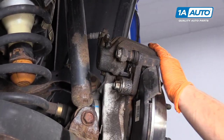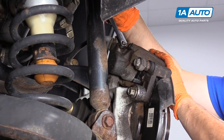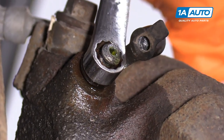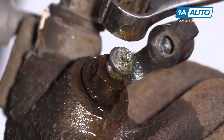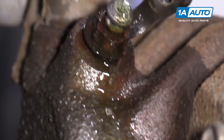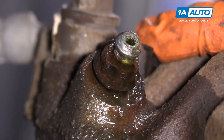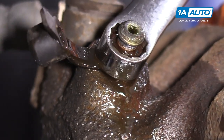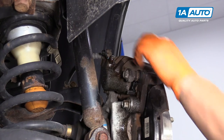Now that we have the rear brakes all together with the caliper mounted on this 2012 Equinox — because we had opened the bleeder screw to push the caliper piston back — we're just going to gravity bleed it. No need to touch the brake pedal at all. We're just going to watch and make sure fluid flows out with no air bubbles. See those little air bubbles forming at the top? We just want those to naturally bleed right out. Once it's snug and bottomed out, just give it a nice half a turn. Use brake parts cleaner to clean it up, put the cap back on, and we're ready to go.